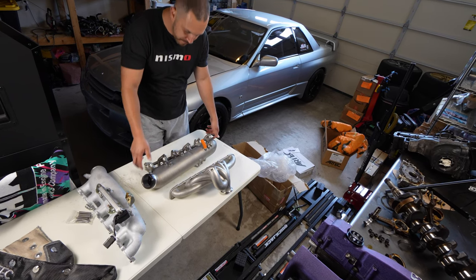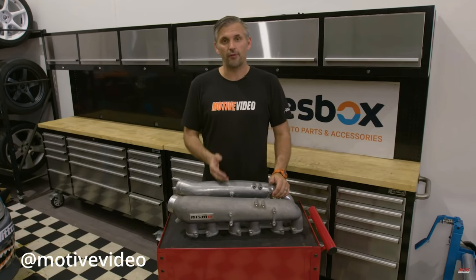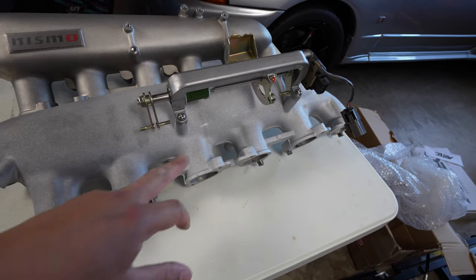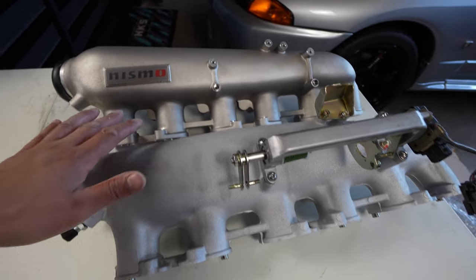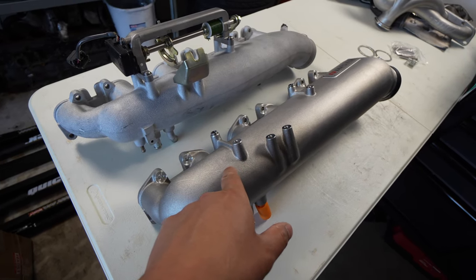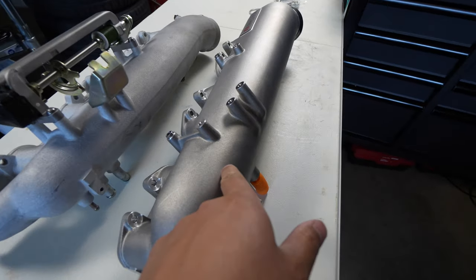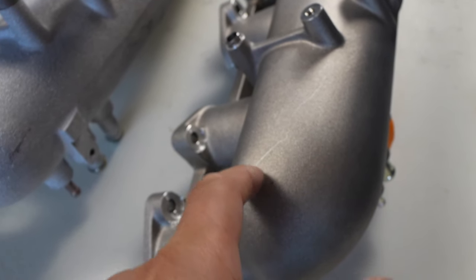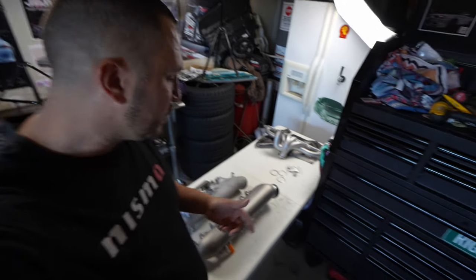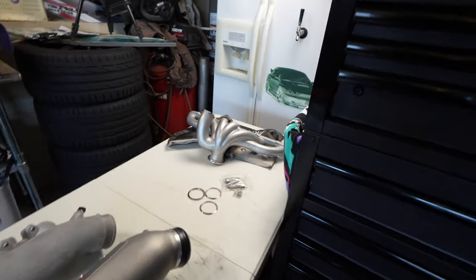I'll put a link in the description to Andrew's video from Motive Video — he covers it all in great detail. By simple water measurement: 3.5 liters is the volume of the factory inlet versus 4.3 liters on the Nismo inlet, so 23% more volume overall. One thing I'm a little frustrated about is that when the box came through customs, somebody cut it open — you can see how it's all taped and re-taped. They scratched my intake plenum with a razor blade going through it. If you want to get one, with the yen vs US dollar still really low, I only paid about $1,100 from Blackhawk Japan.